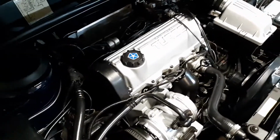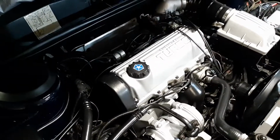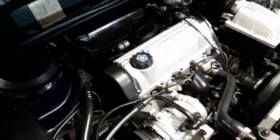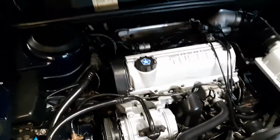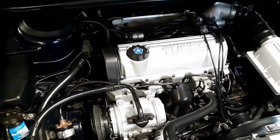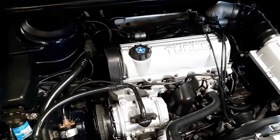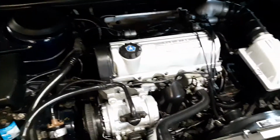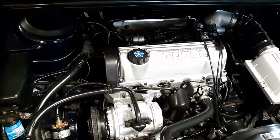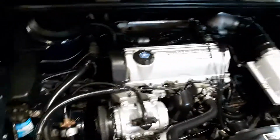Also, I advanced the camshaft one or two degrees forward. It gives it better power down low, which a New Yorker being heavier needs. I might go back to running it straight up. I haven't decided on that, but for now, I noticed it runs really awesome and gets about 28 miles to the gallon, considering how quick it actually is. Notice I said quick, not fast. It will leave a stoplight and smoke the tires actually very well.